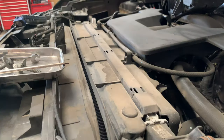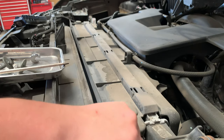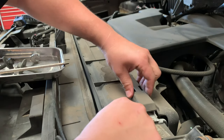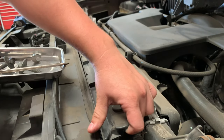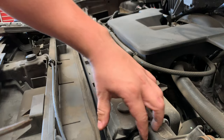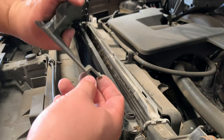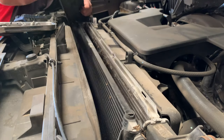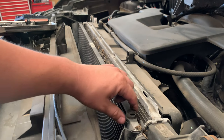First let me blow some air in here to get all this dust out. The condenser is sitting down here and we have to remove this plastic cover — the best way is to pull it straight up from one side. There it goes. This side has a little clip on the bottom — once that clip is off you can see it has a little tab, just pull that off and it comes all the way out. There's another tab on the other side too. This is our condenser right here — this dark one — and you can also see where it's leaking from right there.